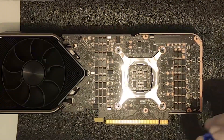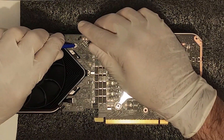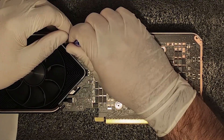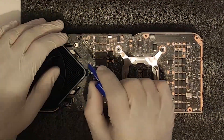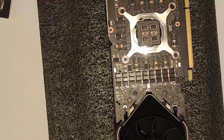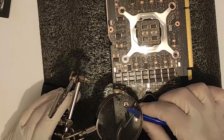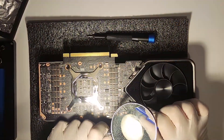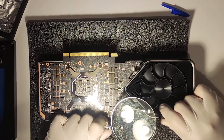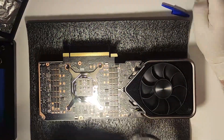The last cable — the LED one — is a pain to get out. You will need to push the metal strap out towards the front of the card; it has two distinct clicks when it unfastens. You need to remove the cable straight up — do not pull on the wires or you will damage it. I already knew this from other teardown videos, but I still used a magnifying glass to better inspect the connector — that's just how paranoid I was about it. This is frankly a ridiculous proprietary solution, but I must admit these design decisions are usually made with an overarching goal in mind — be it cost or reducing assembly time — so it just ends up not very end-user-friendly when poking around where you are technically not supposed to poke.